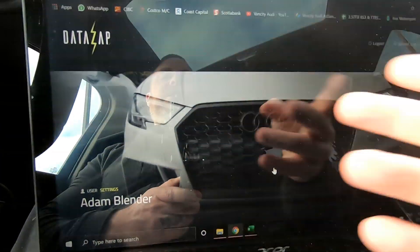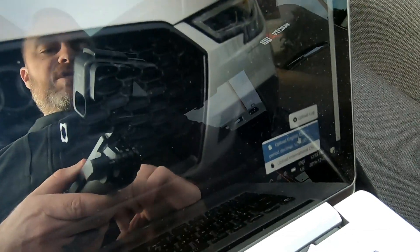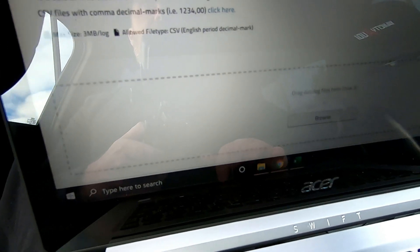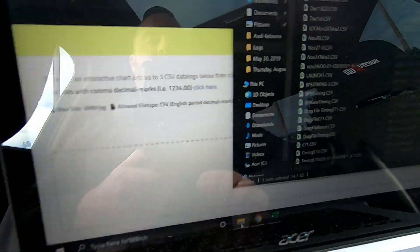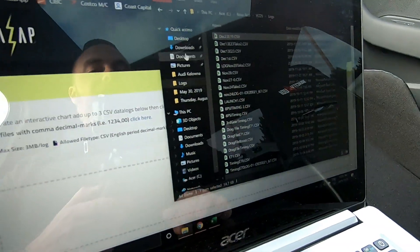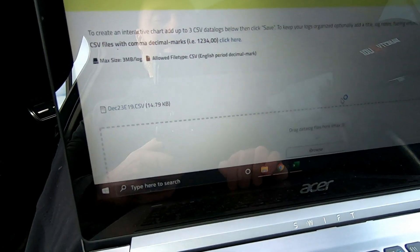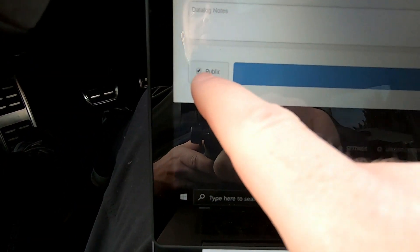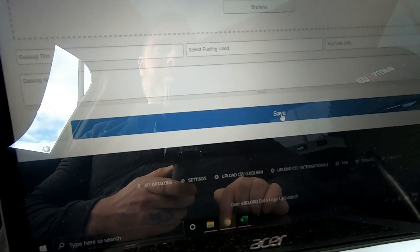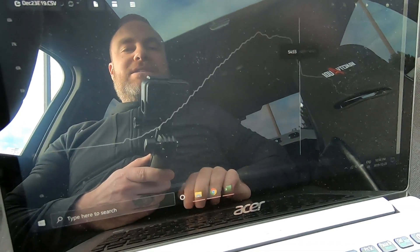Once you're in the program, go to Upload Log and upload the English CSV. It will ask you to find the file on your computer. There will be a folder called Logs under your VCDS folder — I have a hundred logs in there because I do this all the time. Drag and drop the file in the appropriate spot, then scroll down to the bottom where you'll have the option to make the record public or not. It really doesn't matter. Hit Save and it will populate an actual graph of that run.